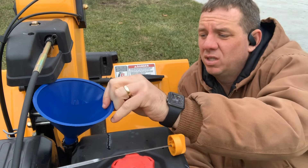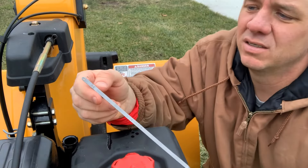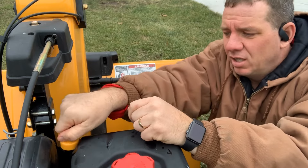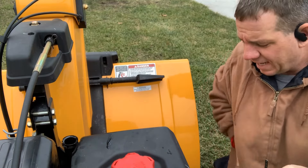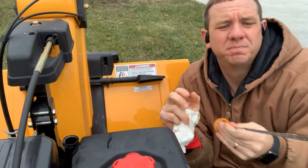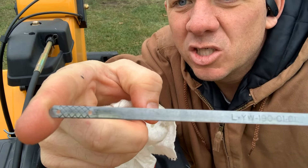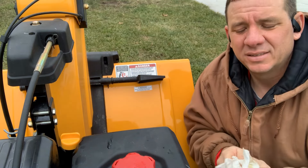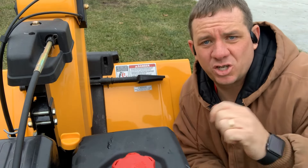Make sure you double-check your dipstick. Give it a few minutes to settle in, then check your dipstick to make sure it's on the high side or the low side — you may need to add a little bit. You don't want to overfill it either. If you stay right around that quart and a half, or you could put in a quart and start checking, adding just a little bit until you get right to high. There it is right at the high mark — just perfect. It might be a little bit on the high side of high, but that's not going to hurt it. You may prefer it just on the lower part of the H, so check it and then add a little bit more.